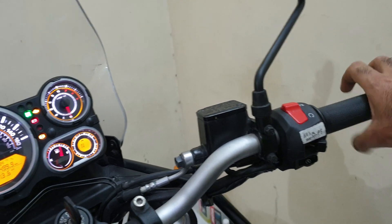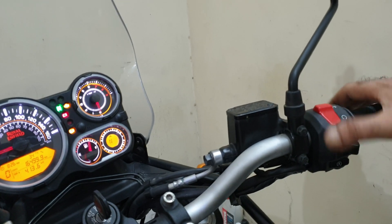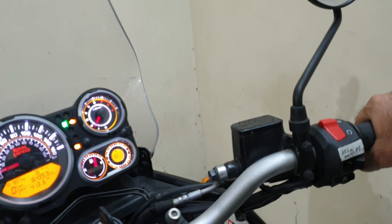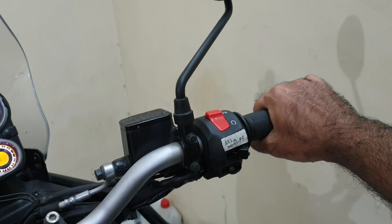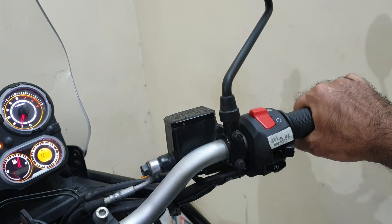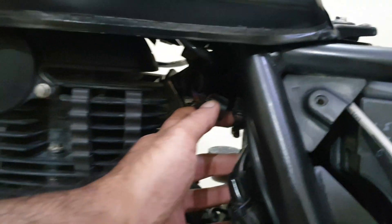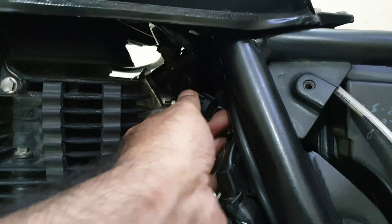It is even dying out sometimes. If you give full throttle it will somehow manage, but it will be erratic. On slow pickup — accelerating slowly — you'll feel lots of problems, and again sometimes it's going to die out, sometimes it will just rush through. So that is what we need to check first — that the TPS is properly connected.